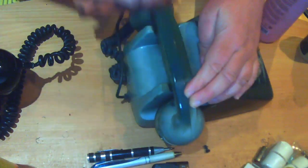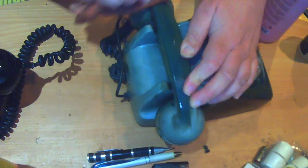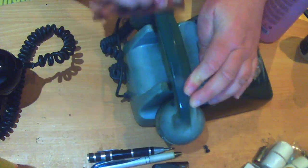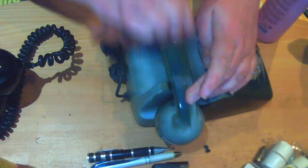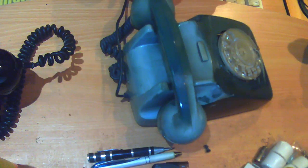But this is doing something, I think. I'm pretty sure it's actually doing something. It feels smooth. When you do it with the neat acetone, it makes the surface rough. But it does smooth it out again when you do it with the watered down. So you don't need the methylated spirits. It said in my other video that I cut the acetone with methylated spirits, the alternative to the Retrobright process. Apparently you don't need the methylated spirits, you can do it with water, which is what we're doing here.